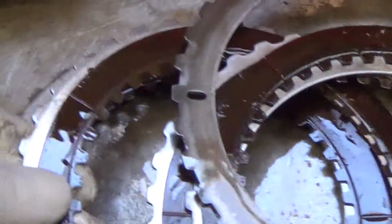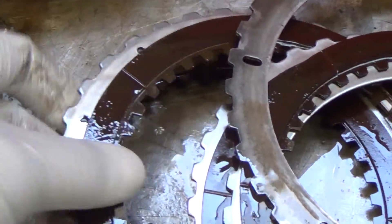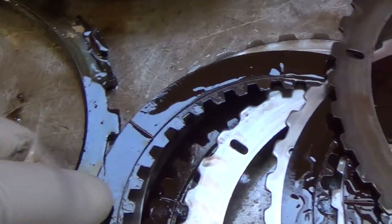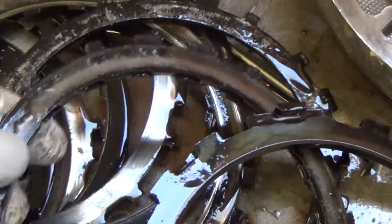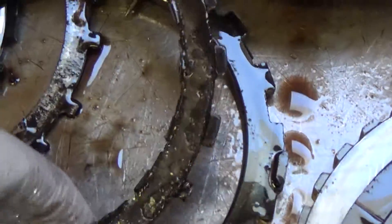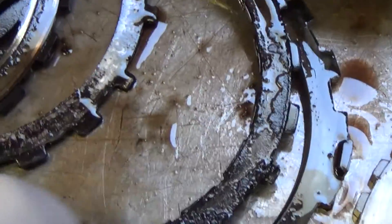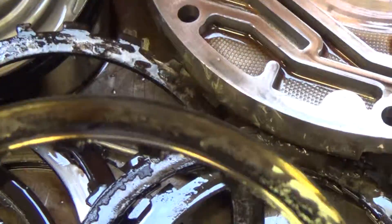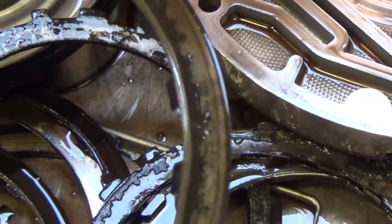You've got to go in reverse. If you look on the clutches with the internal teeth, they have a lining and they're tan — that's the way they're supposed to be. These other clutches that control third and fourth, the internal teeth, there's just no lining left on them. I mean, this ought to have clutch lining on it.